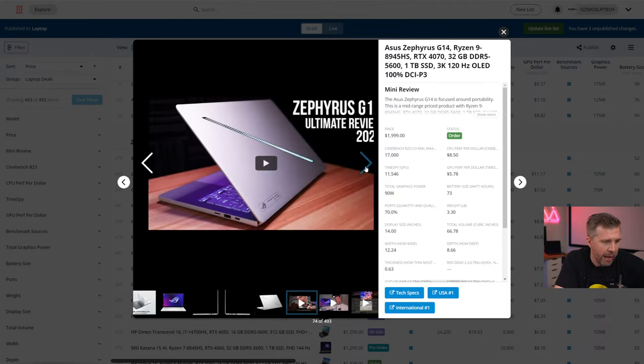All right, so now, same exact overclocks. 2,300, 2,250 versus 2,085, 2,100. So we're getting significantly more boost clock on the G14, 90 watts of power on the G14, 63, 64, 65 watts on the Omen 14. GPU temps are warmer on the G14 at 70 versus 58. CPU wattage is interesting, 10 watts for the Ryzen, 28 watts for the Intel Ultra 9. So the same total watts going through the system on both laptops, but more watts going through the GPU on the G14 than the CPU. On the Omen 14, the CPU is just taking a lot more of the wattage.